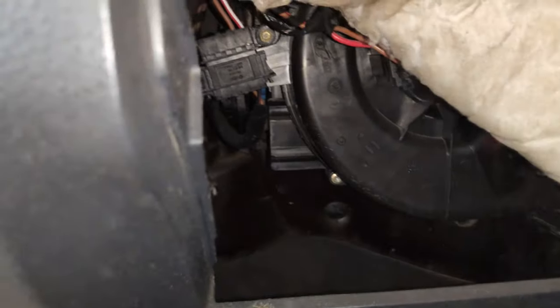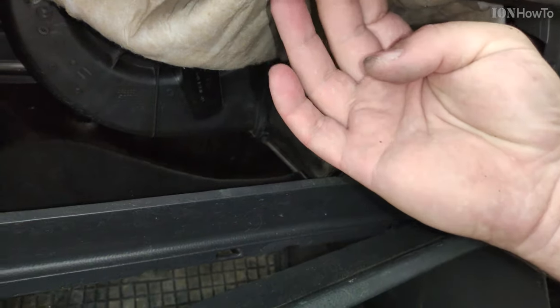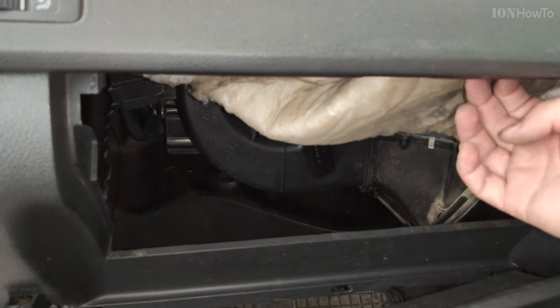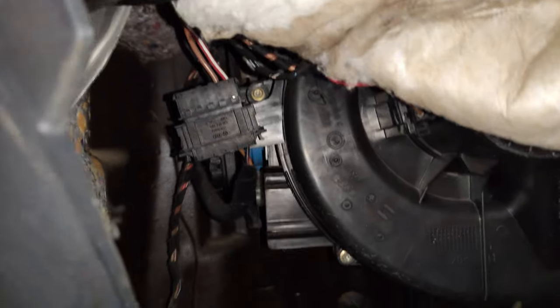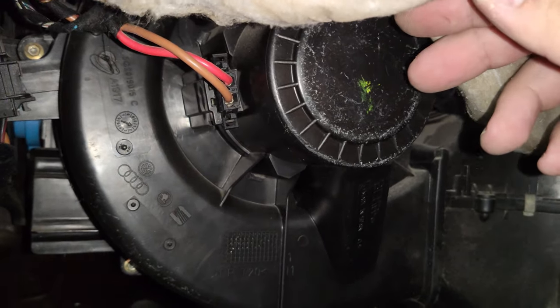If you touch it with your finger a little bit, okay, it's not a big deal, but don't use tools around it or pull it or anything. Best thing I found is to secure this mat right there, so it hides the airbag parts. So if I'm doing anything on the fan there, any screwdriver, there is no chance really to hit the airbag connector or anything. I replaced this a long time ago.